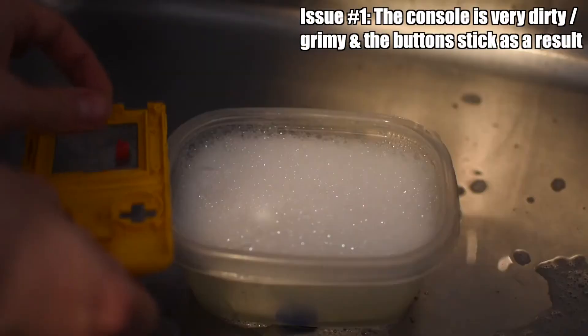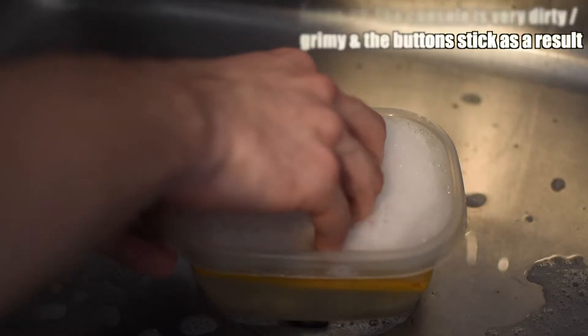Now is the easy step I was talking about — just cleaning all these plastic parts. I'm going to show you two different things you can do, both of which are equally effective. The easier way, which will help with stickiness and gunk, is to get a small bowl, put in some warm water with dish soap, and then soak the plastic pieces in that. Please note — do not do that if it has stickers or other material that can be lost. The buttons and front casing can easily go in there, but the only part on the Game Boy Color I would not advise soaking is the back part. Leave that soap for a good 10 to 15 minutes, maybe even more.